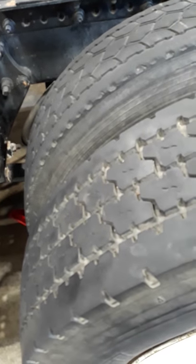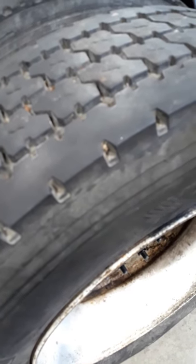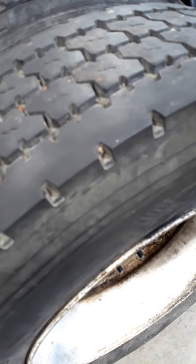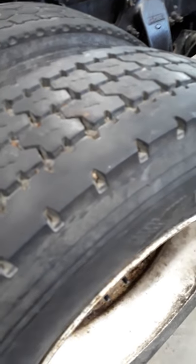As far as inflation, every tire on this truck is underinflated — ranging anywhere from zero to about 65 PSI; one is completely flat with the bead broken down on it. They should be 115 PSI on the front axle and 105 PSI on the duals on the back, so all tires are underinflated. An underinflated tire is how we can have a zipper failure because it damages the sidewall. For safety reasons, they don't want you to air up a tire that's more than 20% low on inflation — you have to remove that tire, place it in a cage, and air it up remotely so you're not beside the tire if that zipper failure occurs, because it can maim or possibly even kill you.